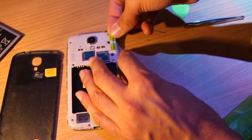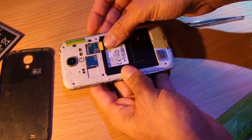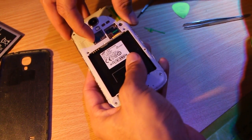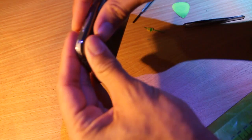We're just going to stick that tape over here. Now it's time to reinsert your cards and your battery, then put the back of your phone on. Just make sure it all sits together nice and snug, especially where you've put the tape, and double-check that you don't have any of the bezel that hasn't clicked back into its original position.